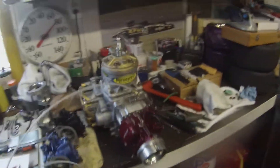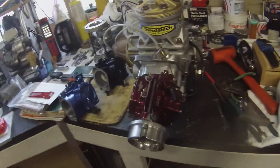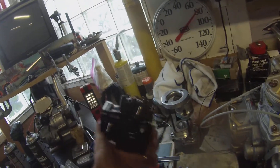That's the best I could do with the available bosses to get this thing going. The reason I've got these other carbs — they're all the same carburetor, all the Keihin CDK2. It's a watercraft carb, watercraft race use only. This is a Sudco modified carb — it actually had a little Sudco sticker on it when it came new. The red one is a DG modified CDK2 carb. And this one is going to be your stock standard, right from the factory carburetor. You'd imagine they'd just be plain cast aluminum, but they did paint them.